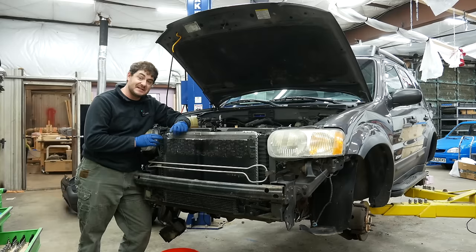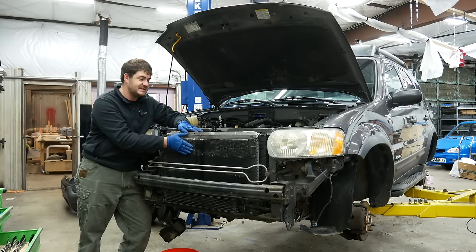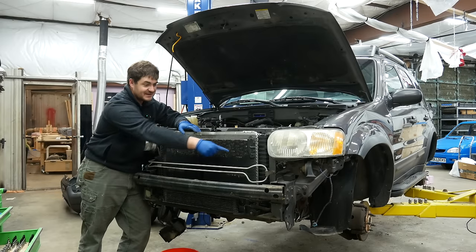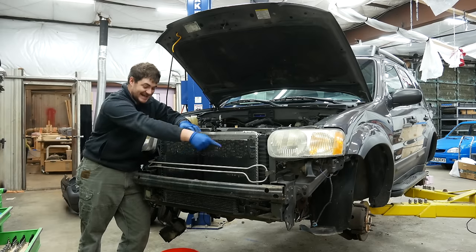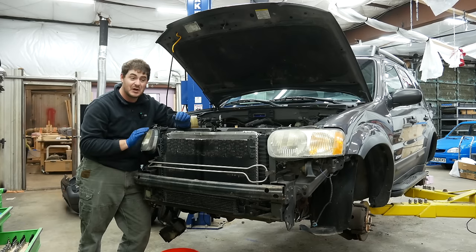I find this really amusing. This is probably commonplace, but I've never seen it before. There's four heat exchangers up here. There's the AC condenser. There's the radiator for the engine. There's a small radiator down here for trans fluid cooling. And this line that goes over there and then loops back is all the cooling the power steering needs. No fins on it, nothing. Apparently this line is all that's needed to cool the power steering fluid. This is one step away from no cooling at all.